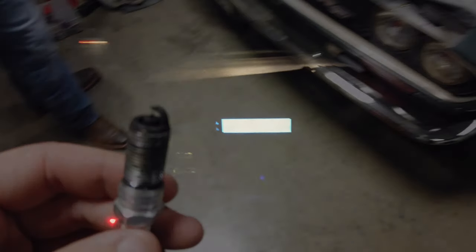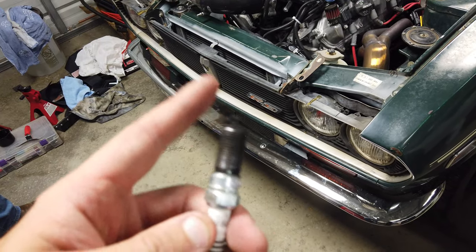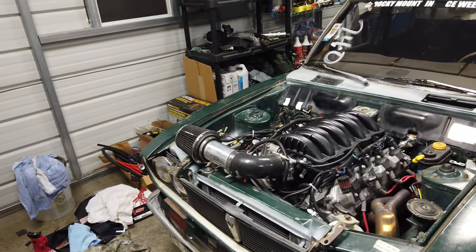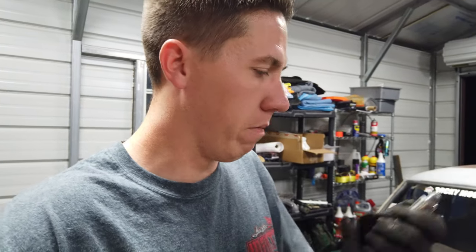Here's the plug I just pulled out of that cylinder — it was a new plug I put in when I changed the injector, so it looks like it was starting to clean up. I threw a brand new plug in that cylinder, went around the block, and pulled it again. The plug looks pretty good — I can see some heat but it's still super clean, and it's definitely not black like it was before. So it looks good! Now it's time to make some tuning adjustments and try to do all that before we head to Bowling Green for LS Fest. Thanks for watching — hit that subscribe button and we'll see you in the next video.